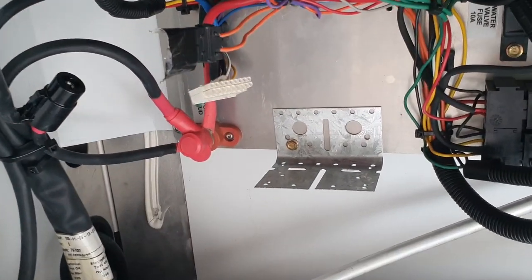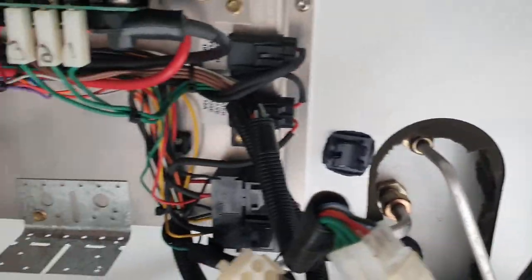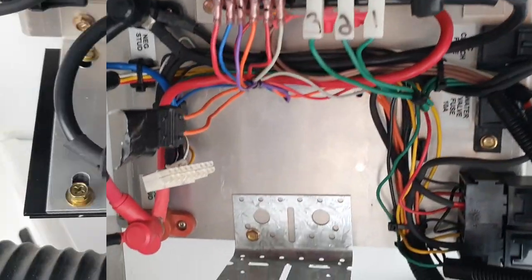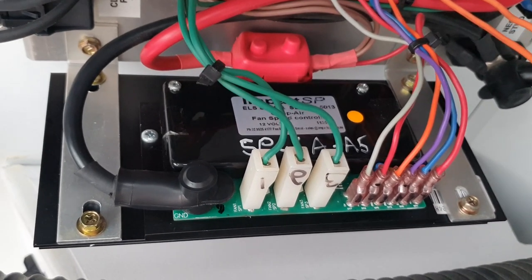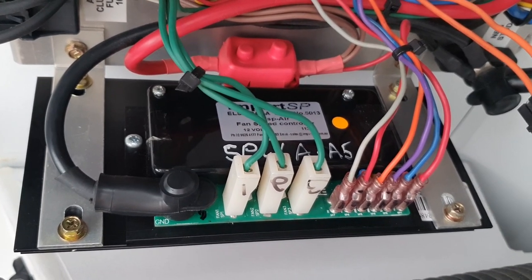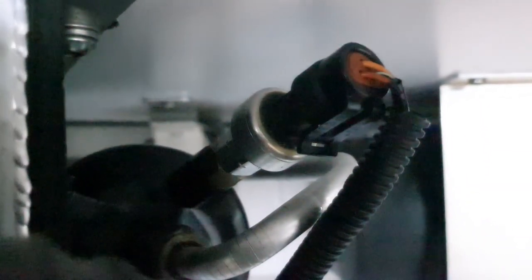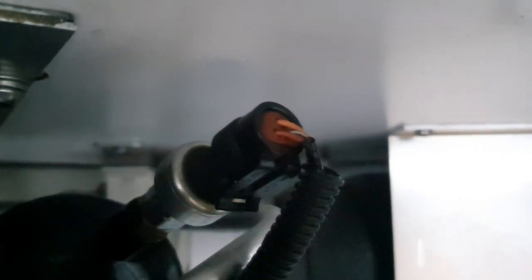To replace that, we're just going to use fan speed controllers and wire up all of this stuff with relays. The other controller on this board is used to control the condenser fans as well as the pressure switch. This is what your pressure sensor looks like — it's a pressure transducer, which is what it's actually called. You have your red as your 5-volt input, your orange is your signal, and the other wire is your ground. It's connected at the dryer.